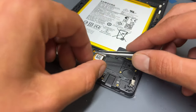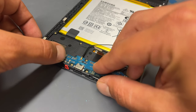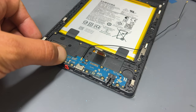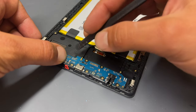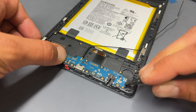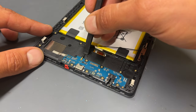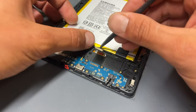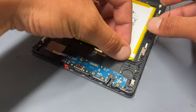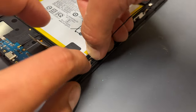Let's reinstall the subboard now. Remove the masking tape protecting the sub-to-main flex cable, then carefully place down the subboard. It does clip into place — one tab went in fine but the other just needed a little bit of pushing down with the back of the spudger. Begin realigning the coaxial cable into place using the plastic spudger. There is a groove that it sits in, as well as some small metal clips that secure it on the side of the chassis.